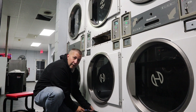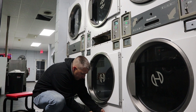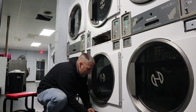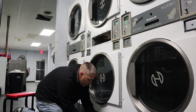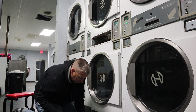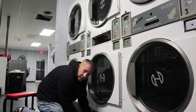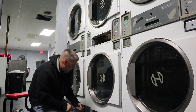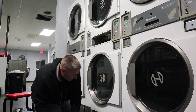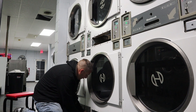For the most part it's functioning fine for customers. Once in a while somebody will leave a note on a machine. I know some laundromat owners have tags where you can write comments — I tried that and it didn't work at all. You get a lot of useless comments. So what I do is once a week I go through and vend every machine — I put a quarter in every dryer, listen to it, let it run the whole cycle to make sure it got warm and is the same temperature as the machines next to it. That's how you know if your machines are working.